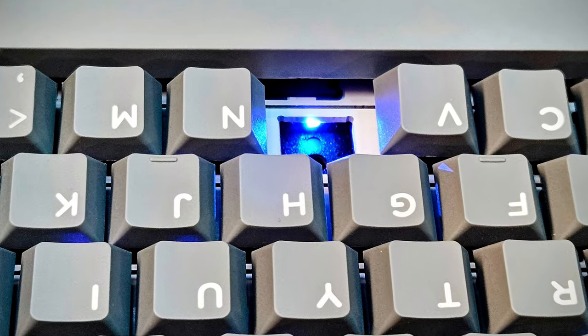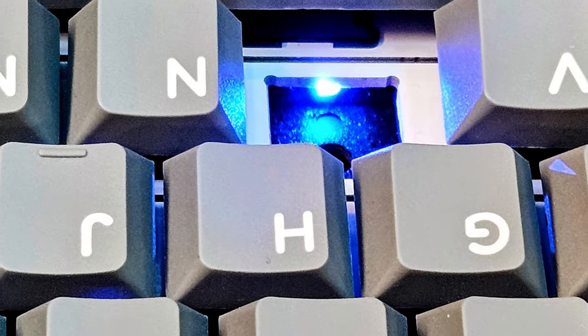In my opinion, it's very interesting and it makes this keyboard stand out from the rest. Now, I know there's some people that don't like RGB or don't want RGB, but for those that say, hey, that south facing RGB is always kind of pointing in my face, this one is south facing on the plate, but because of the position of the LEDs on the plate, they shine up or back instead of forward into your eyes. So for those folks that don't like south facing because it tends to strike up or forward to them, they're not going to have that issue with these. The light's going to go forward or towards the back of the keyboard. Another thing I noticed, despite me using switches, the BCPs, that do not have an SMD LED window, I still was able to see the RGB quite well.